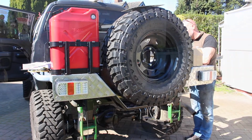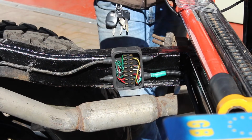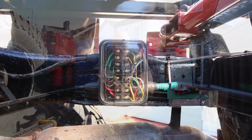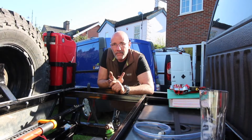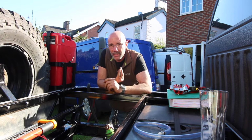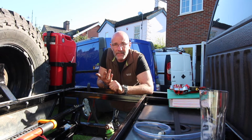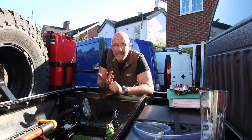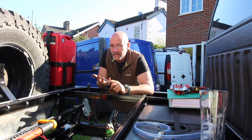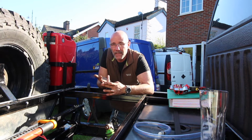In the case of this Mitsubishi, we had 8 cables coming to our wiring loom for these rear lights. We had the earth cable, the left indicator, the right indicator, a fog light, which in this case is going to light one side of our light clusters, and the reverse light, which is going to do a light in the other cluster. We had the tail lights, which also operated the number plate lights, and then a brake light, and another tail light. So we actually had a left and a right tail light stroke number plate light.